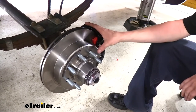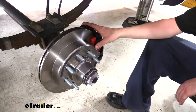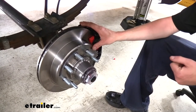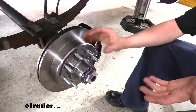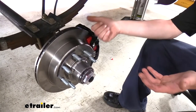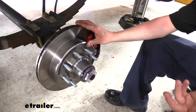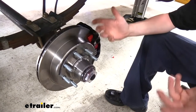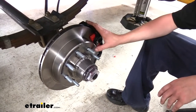These are also going to be less maintenance than drum brakes. Drum brakes, even though most of them say they are self-adjusting, the self-adjusters just don't typically work as well as you'd like. They sound great in theory, but a lot of times they only adjust when backing your trailer up, and you usually need to do a pretty good backup and stop to make the adjuster wheel even adjust. There's a lot of situations under normal driving where it's just not going to adjust and you'll have to do it manually. There are also a lot more parts inside a drum brake system, so if you do take it apart and need to do any repairs, it's a lot more work than with our setup here.